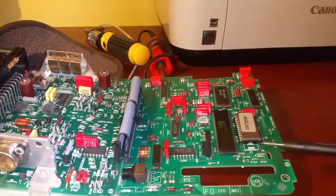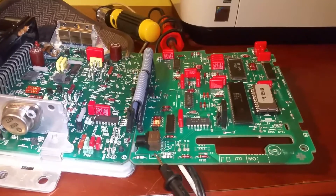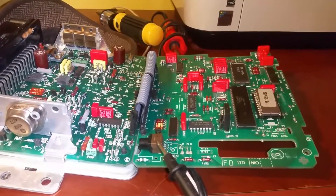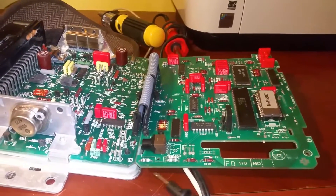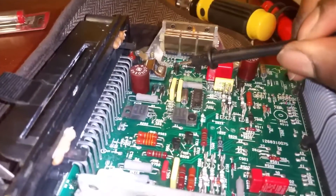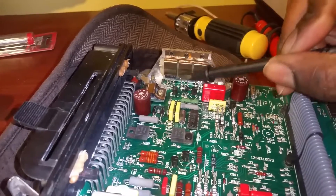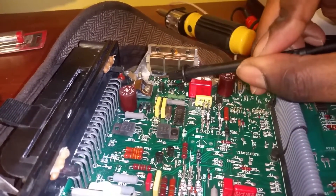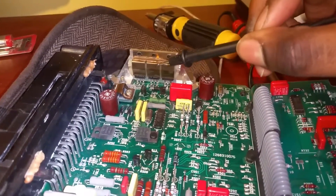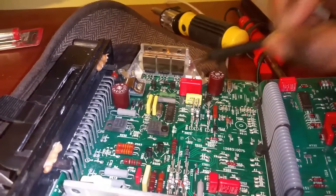Other stuff isn't mainly anything to be concerned about. This is your fuel quality module - it controls your fuel quality and actually changes per the type of vehicle you have, so you'll see different ones in 911s. As we come to the top here, you see these circuits. This one right here is the first one - it usually goes with your injector circuit. After that you have your ignition circuit, which is a primary circuit that deals with your ignition system. And this is actually the power supply, the VCC, that goes over to the digital side.